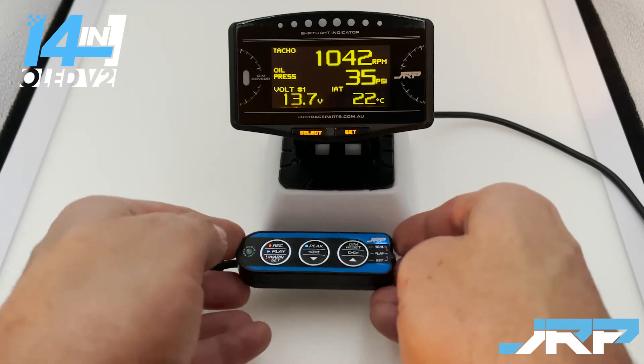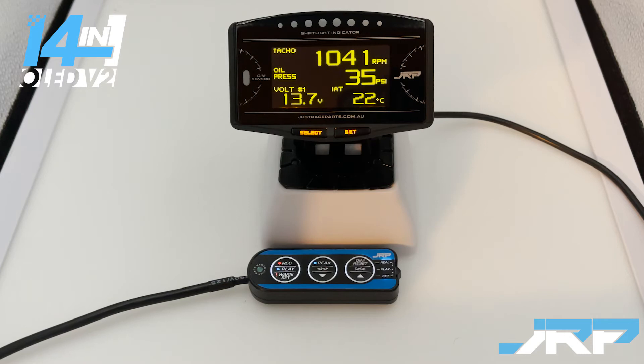Move the switch back up to play. The warning is now set. Apply some RPM to the motor — we're up around 2,000 RPM — and we'll just drop the oil pressure. And there you go, the warning has been triggered. The same thing will happen even if we're up at a much higher RPM, which we demonstrate here. Okay, we're at 5,000 RPM, and again oil pressure goes under that value and it goes off.